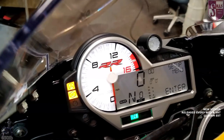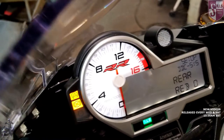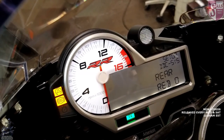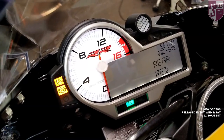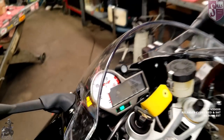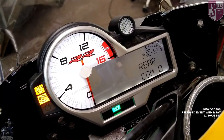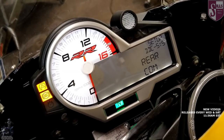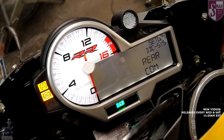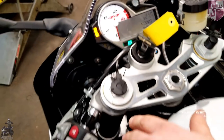To adjust, get back to the setup menu, enter it, go to DDC, and hold the set button again to enter that menu. Now we're in and can adjust rebound and compression on the rear — it has two adjustments. I'm going to take out some rebound since I'll be riding this bike with the rev limit on during break-in. We'll drop that and drop compression by two. I've been taking off three and it's still been fine for street cornering — it just keeps me from getting kicked over the seat.